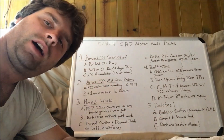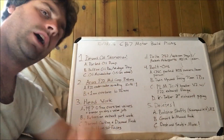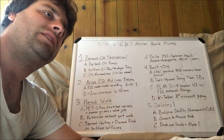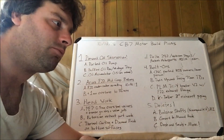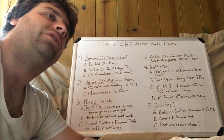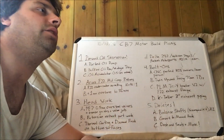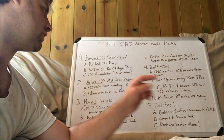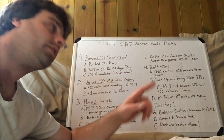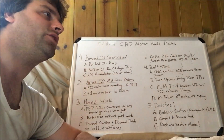Then we're going to move to the block. I'm going to keep the F22 crank and rods, and I'm not going to mill the head — I don't need to. Arias makes these awesome pistons: they're mid-compression and they have a negative 2.5 cubic centimeter dish, smaller than the F22 pistons, which brings up the compression. According to Zeal Auto Works' calculator, they bring it up to 10.96 to 1 — right below 11 to 1.